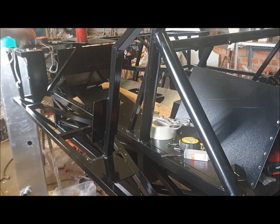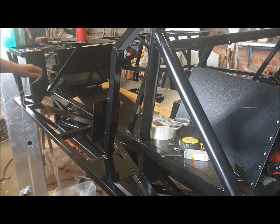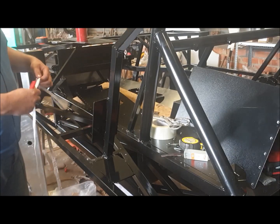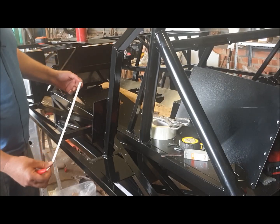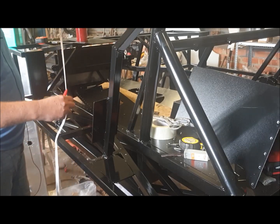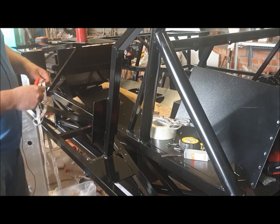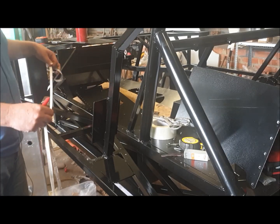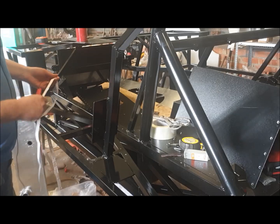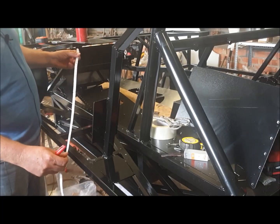Their way of doing it — which I'm so pleased to be able to use and show you — is basically to take some elastic and mark a series of holes on the elastic evenly spaced. In this case I did them at 10 millimetres, such that when you then stretch the elastic out across your panel, your holes move apart but they remain evenly spaced. Due to some technical issues with dropping my phone yesterday, I'm recording this introduction after having done the rest of the video, so apologies for that. I just wanted to do the introduction to make sure the rest of the video made sense.